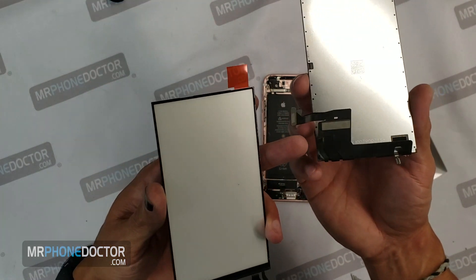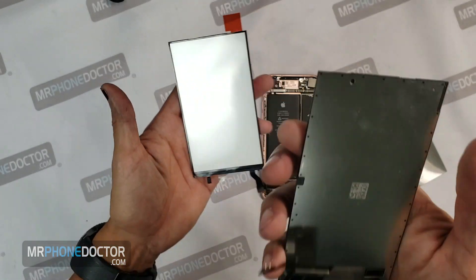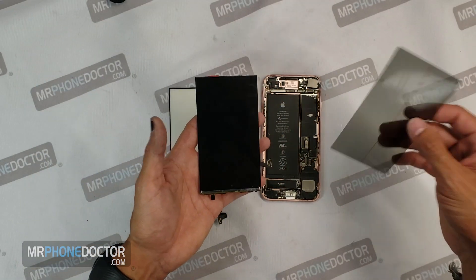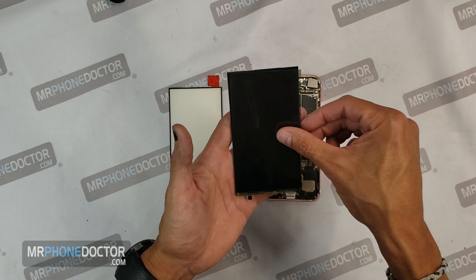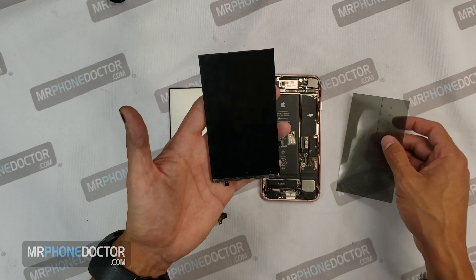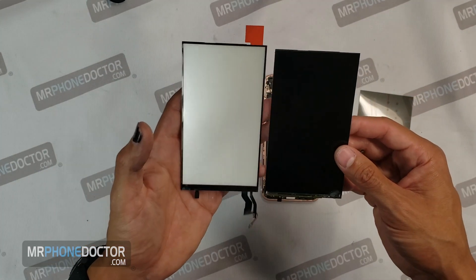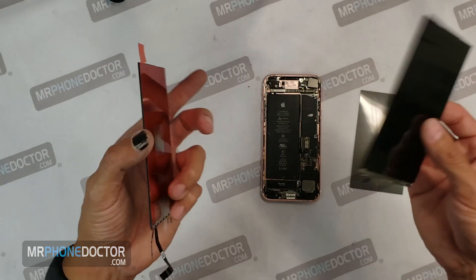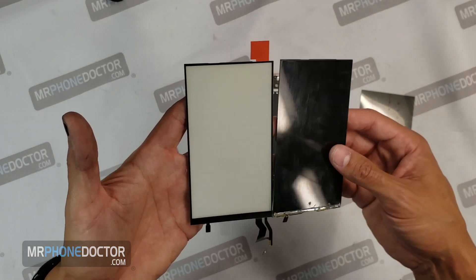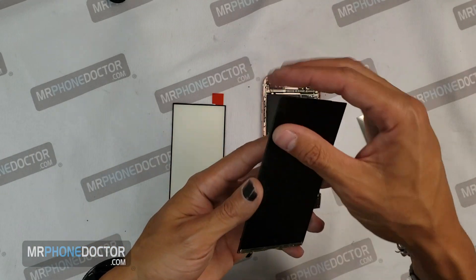The backlight is connected with this little flex right here. Once connected, it produces a light which hits the LCD and allows you to see the display. You do need a polarizer laid over the LCD because without it you will not have any picture — it will just look like a bright white light. I am going to show you guys in further detail. I hope this video comes to use for you guys when you are disassembling and refurbishing these displays, giving you an idea of how they are put together and what to watch out for. The majority of the time the polarizer does not need to be replaced.